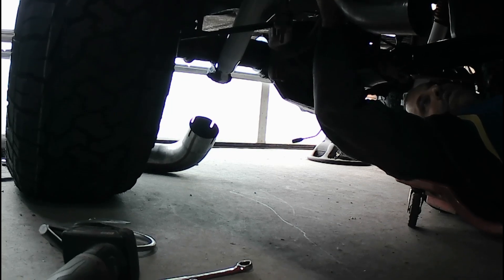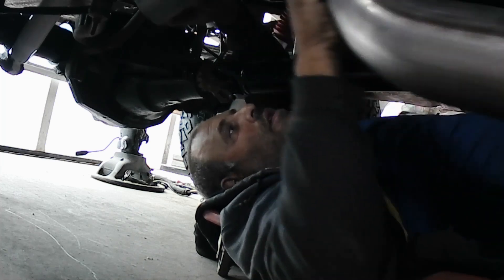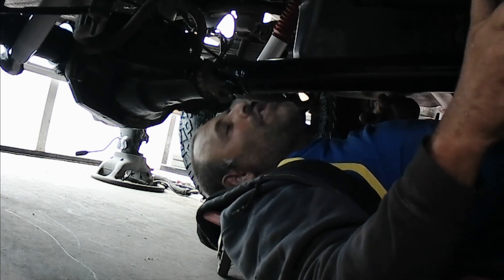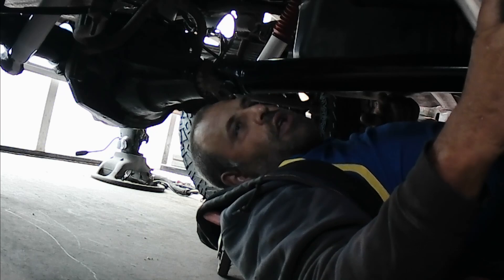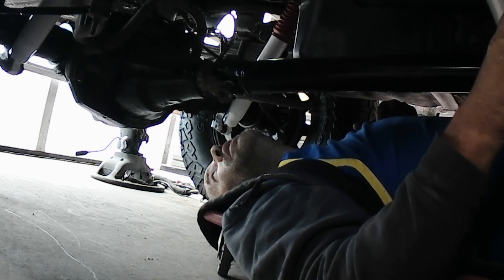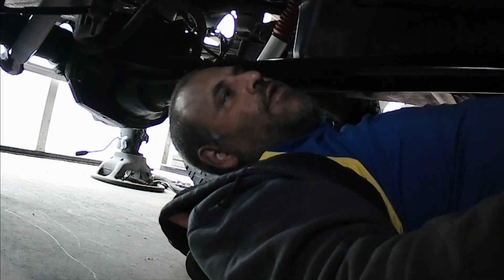My next problem is getting this pipe to line up over the axle. I gotta have about that much of a gap on it, but with that much of a gap I'm hitting the fuel tank. What I'm going to do is weld on a piece I got left over from my crew cab — about an 8-inch piece — weld it on to here, extend it out, and figure out where I gotta cut it back down to. It's kind of hard to hold and measure when you're the only one up here. So we'll get the pipe on and work our way back to the front. I also got to do the crossover there for the up-pipe still as well.